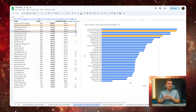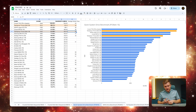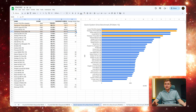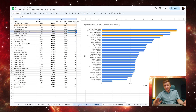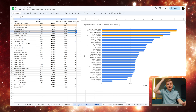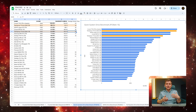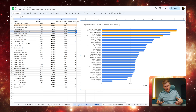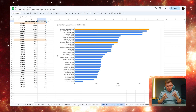The Quick System benchmark tests the drive as a secondary drive for very light tasks — opening documents, moving photos — not running an OS or programs. The 2TB version is very close to the Crucial T705, within about 1% — one of the best I've tested. The 1TB is a bit slower; I would have expected faster than the Samsung 990 Evo, which is a cheaper hybrid drive with only two Gen 5 lanes. For a secondary drive at light workloads, the 1TB probably isn't worth the premium over Gen 4.